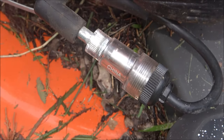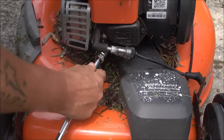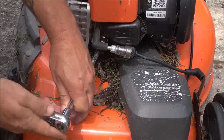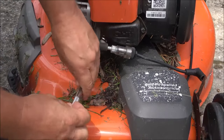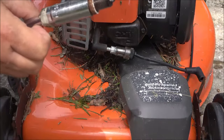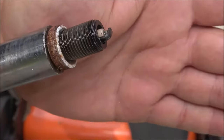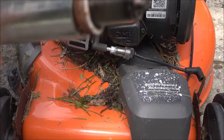Good. Now we're going to pull the spark plug out and see if it's got spark. I'm not sure how I'm going to be able to test this because I don't think I'll be able to see it. But we know we're getting spark — it's all electronic ignition, so we don't have to worry about points. Look at that — you guys see that it's gapped or bridged? That's called bridged. It was bridged with what looked to be like water.